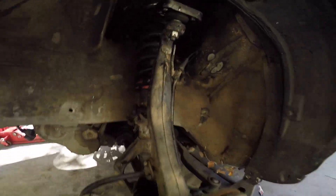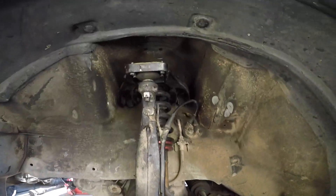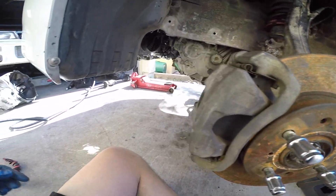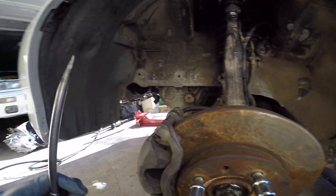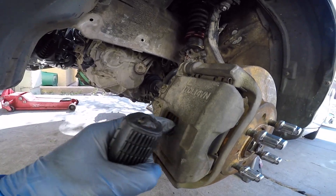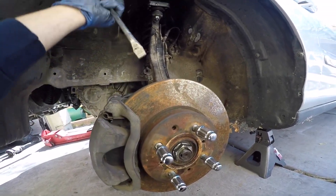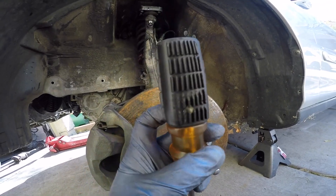That's how easy it is. This bolt here goes through the top, then the four brake line bolts, and then the axle nut. If you need help tightening the axle nut, a little tip: when tightening, put a flat head screwdriver right in between the rotor and tighten it. If you're loosening it, put it right there and it'll stop the rotor. You may break your flat head, so just keep that in mind — I've broken a couple.